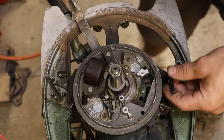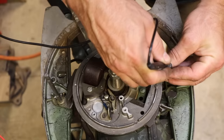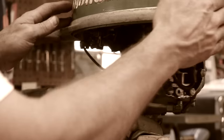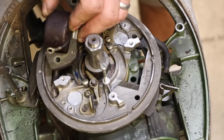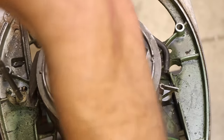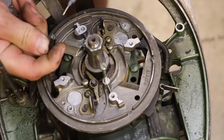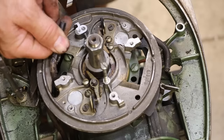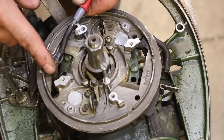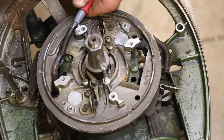I've got a little bit of slack on this and I'm going to cut some off because I can't even get continuity with my meter. There's the wire — I'm right on the wire, and that is the correct wire. So the wire is broken. Let me just confirm this is the wire to the good cylinder — yes it is. And it just pulls right out. Same thing. Just verify that I do have the continuity I'm expecting on this wire. What in the world. You know what I'm thinking? Even though these plug wires look good, they are shot. There are gaps in the wires that the spark is jumping through, but my multimeter can't see the continuity. I think I need to replace my plug wires — let me go get some more.